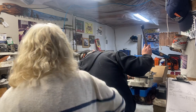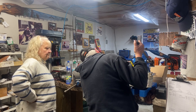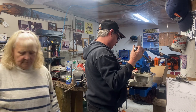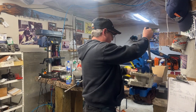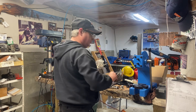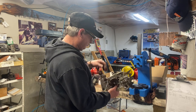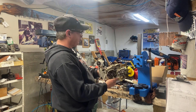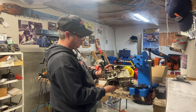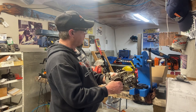I'm going to press down onto that one, holding the case straight so it lines up. Look at that — the tools I made today worked! Here's the first crankcase done on this arbor press with Donny Walker's homemade tools. If you don't have one, make one — that's how you do it. My dad did it for years, now me and Shelly are doing it. Crank spins okay, but I will put the bolts in and make sure the crank's centered. If it's not moving quite right I'll put the flywheel nut on and give it a little tap, but I guarantee it'll probably be just right.